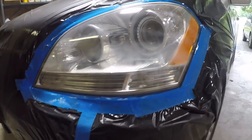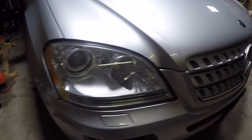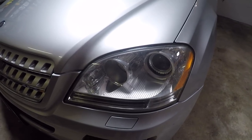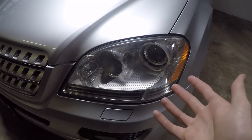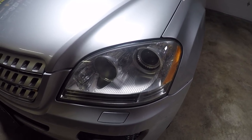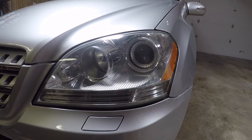Once this dries, we can actually go ahead and polish it, since this finish is going to be very similar to the finish on your car. We might want to wait about a week for it to fully cure before we do that. This is the day after, and we have both sides done. At this point they look very nice and clear — you can see some imperfections probably from the sanding, but overall they look a whole lot better than they did. There are two options: one, we can leave them like this and they'll be protected from the sun; or two, we can wait about a week, wet sand them again with a very high grit like 3000, and then polish them with a buffing wheel for the best possible shine. If you like this, give it a thumbs up and I will see everyone in the next video.